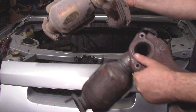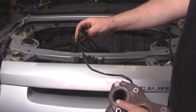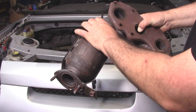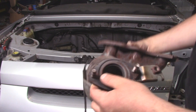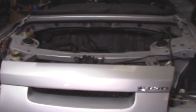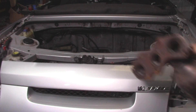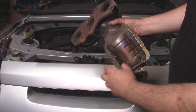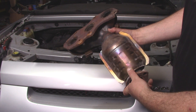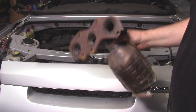As far as the exhaust goes, we're not gonna get crazy. I've got this manifold and this manifold — these are off of an Evora but I'm pretty sure they match the Camry, and you can actually tell because it's got the Evora sensor on here. What we're gonna do is cut them right here and make a pipe that goes down, probably to an X-pipe. I will save the catalytic converters — I don't know if I'm gonna use these ones, but I will try to put some catalytic converters on this car. I live in Indiana so I don't need to, but I do actually want to put them on, same with the evaporative emission system. Keep in mind the reason they put the catalytic converters this close to the head is for startup emissions — once everything is up to temperature it doesn't matter where in the exhaust system it is.